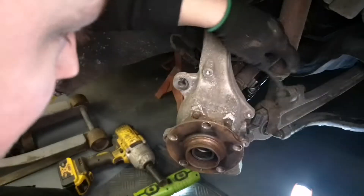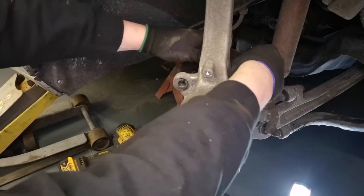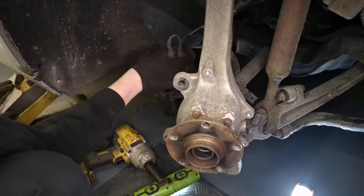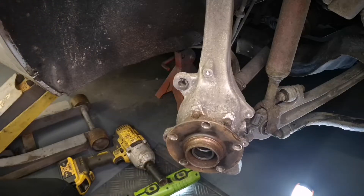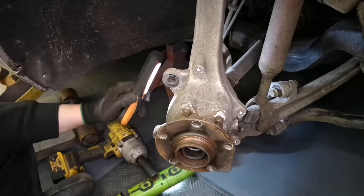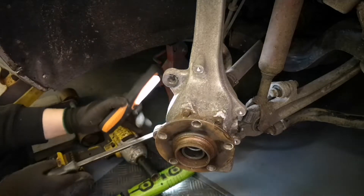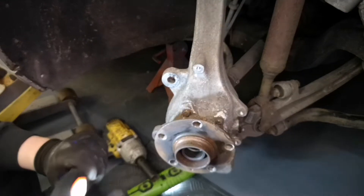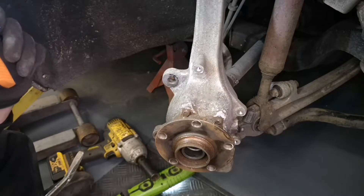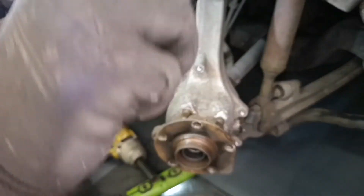That's off. Remove the ABS sensor — don't risk breaking that. The knock sounds like a ball joint to me; it's got a very strong metallic clunk. I just can't replicate it, which is very frustrating. But these Audis have got quite complex multi-link suspension systems, so there's a lot to go wrong.